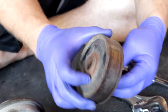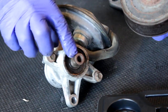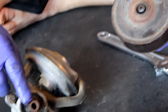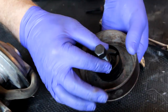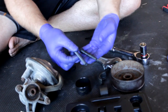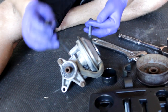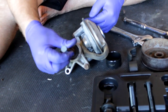There we go — you've officially used the pusher, which pushed through and pushed it off. That's a press fit — when it's a press fit, the tolerances match or it could be just a little smaller, and it fits on that lead-in chamfer. When you press it on, it forces back on. You take the sleeve off and pull both of these back out. You can see how far it took you to push — it was flush to push it out. This one has two pull bolts and two pusher bolts in two different sizes because it's threaded on the inside — that's where you screw in to push. So this size looks like it fits — that's good.